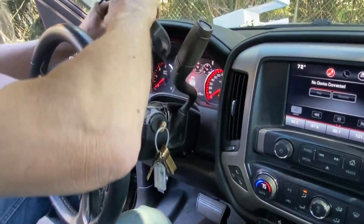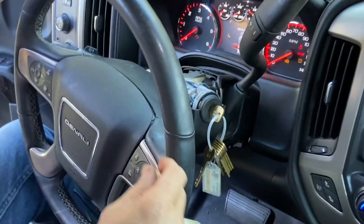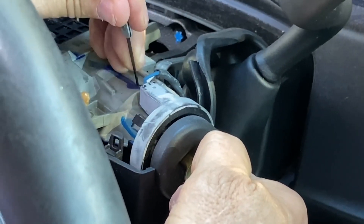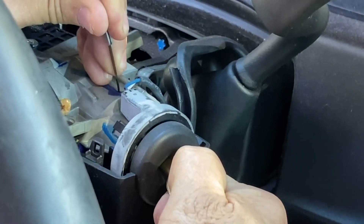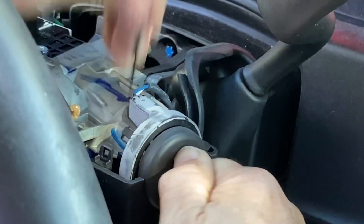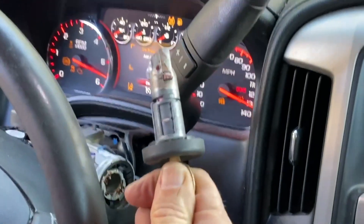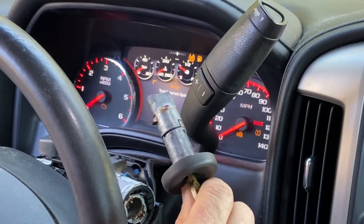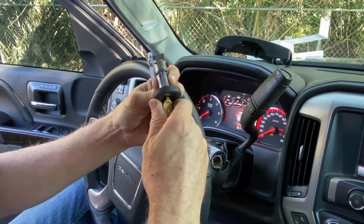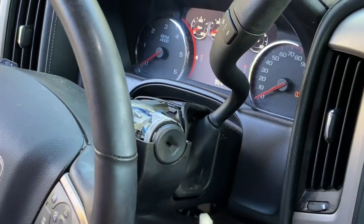The goal of the OctaKeys is to turn this ignition on. Now we can remove this ignition and get the key code and cut a proper key. To take the shroud off, just pull on the edge and it'll come apart. Get yourself an old pick — the retainer hole is right up here on top. Hold this in the crank position, insert your old pick, and you should be able to pop it out. Now we've got the ignition out and you can cut it by code — the code is stamped on it — or you can disassemble it and take it apart. That's the goal of the OctaKeys: to get that ignition turned and then get the key code off of it. You can snap it back in and cut your key.